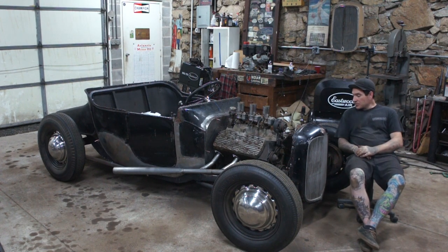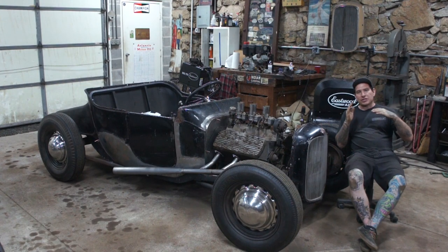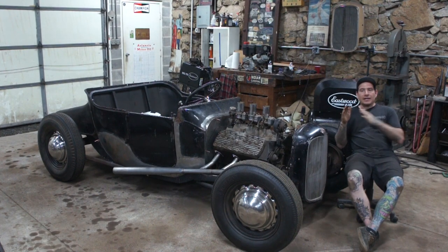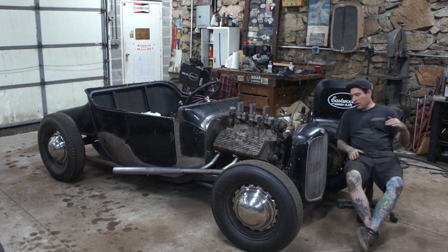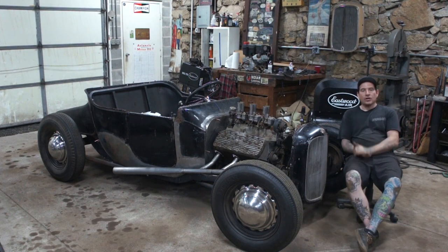So the last thing to note is that I had to push the grill just far enough in front of the crossmember to allow room for when Chris, who's building my radiators at Dick's Radiator here in Pottstown, PA, a local shop, does the water necks. I need the water necks on the bottom to do a 90 and come straight up. Because when they come straight out, they would have gone basically under the crossmember and through the spring. And anybody that knows anything can probably figure out what would happen if it was like that. The suspension would potentially interfere, and we could have some major issues when the suspension compresses fully.